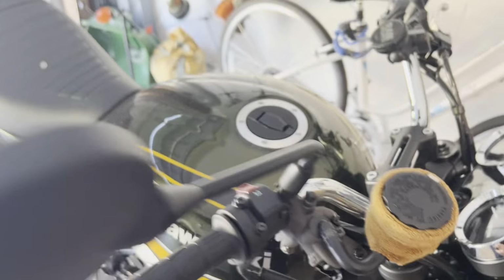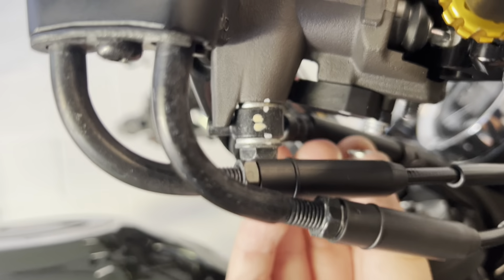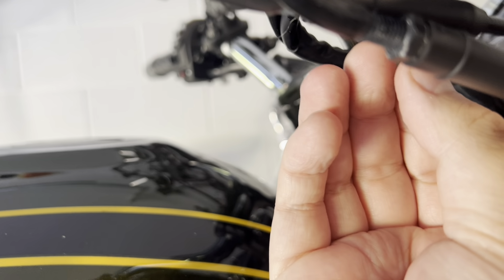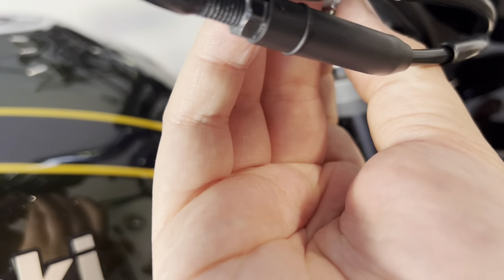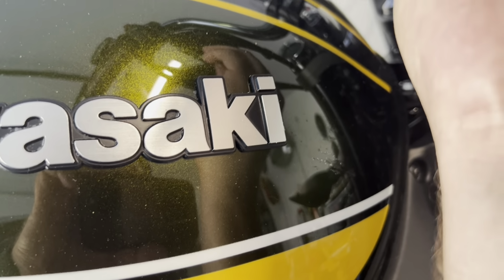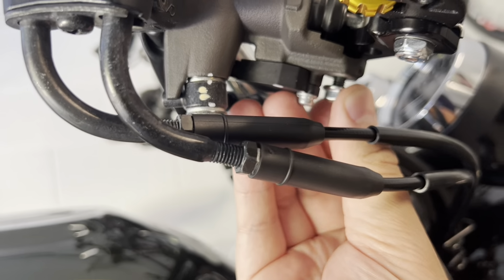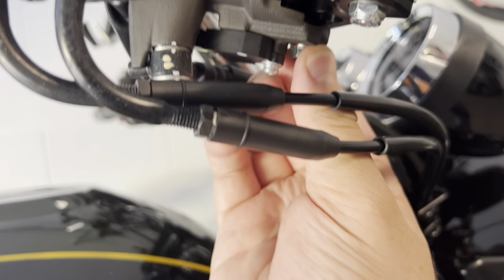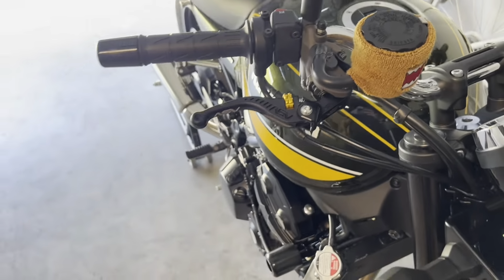So what I'm gonna do now is take this nut, and let's make sure we still have play, which we do. We're going to come down here and thread this guy on, if we can get it on there. Actually, it should be this guy, I'm sorry. It's gonna be that one right there. So that bolt is where we want to go onto. I'm gonna take a little socket and give it a little snug, and we'll be good. Just so you know, this bottom bolt is a 10 mil, so you can use a 10 mil to take that off. So we are completely snugged up. Our brake side is on.